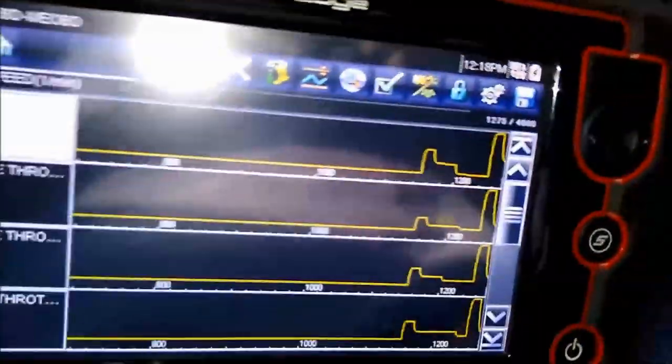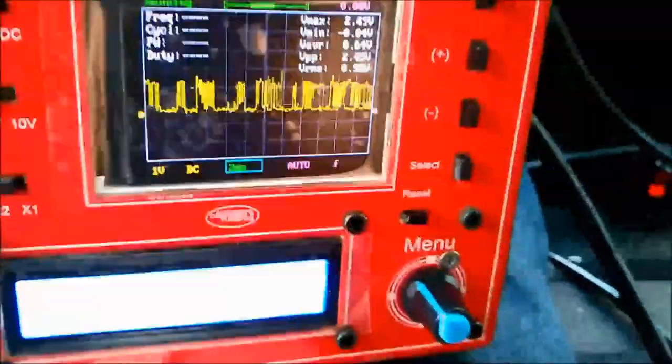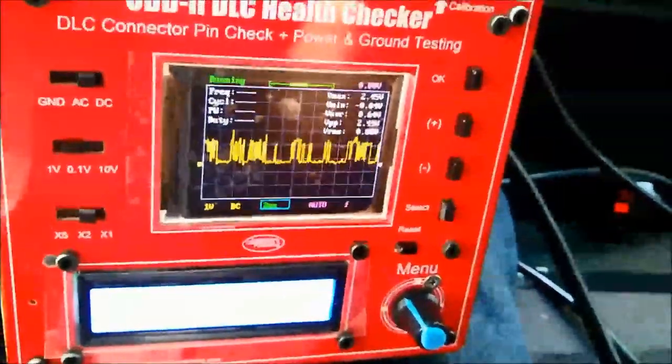The second thing that you should do when it comes to CAN vehicles is, if it doesn't communicate, one of the modules is shorted, and then you would have to start disconnecting modules. Here on screen, you can see a gateway in the diagram.